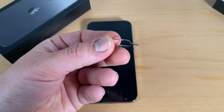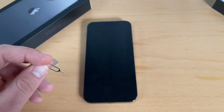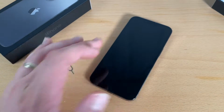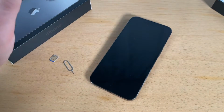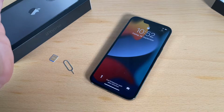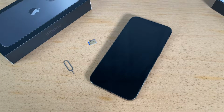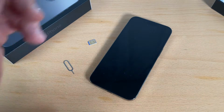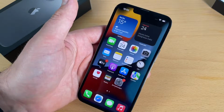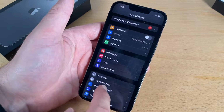This we do not need to replace, because this works with software-based operations. If we are going to use that eSIM, it is an embedded SIM, or an embedded universal integrated circuit card. It is a form of programmable SIM that is embedded directly to the device. And with that iPhone 13, that is possible to use.